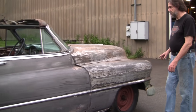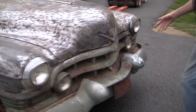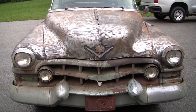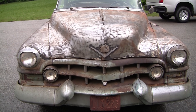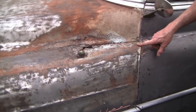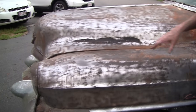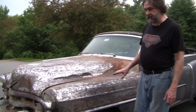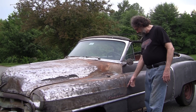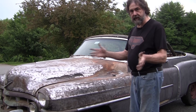This front end is askew. We've got to take the bumper off as I mentioned. We're going to straighten out this grille section, get those cleaned up, totally de-rust those and get them ready for plating. Over on this side, this fender is askew, and there are no indications this was ever in a hard-hit accident — no evidence of any major crumpling. So for some reason this fender is over a little bit and the alignment is way off. We're going to take these one at a time. We might have to take both fenders off to get the nose aligned properly.